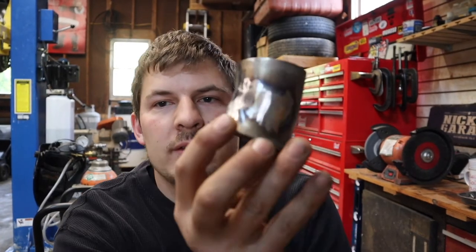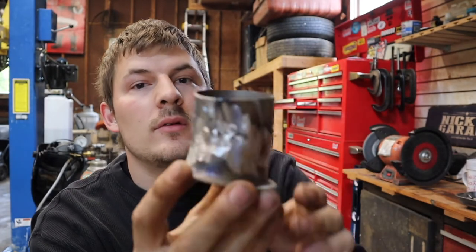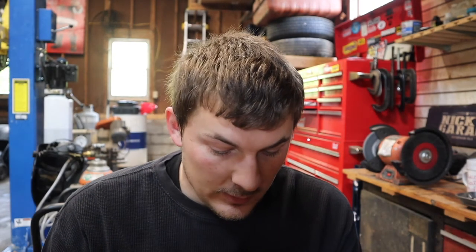We got our piece here — it's all welded out and ground down, got the bend. It looks okay. Only having a small 110 MIG welder, you've got to use what you have — I don't have a TIG welder so we can't make it look that nice, but it will function. The next thing we're going to do is mount both of these on the headers, tighten everything up with the gasket so we can see where we need to go. We'll hang the old exhaust about where we want it and then see what we need from the headers to the existing exhaust. I'm going to go ahead and hang these on the headers real quick and we'll see where we're at.